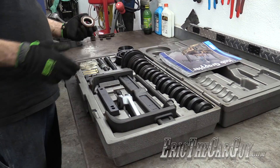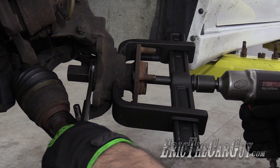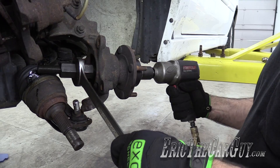What I did do today is this Nissan that's behind me — I was able to replace the front wheel bearing with this alone. No press, no nothing. I'm showing you footage of it now: it pulled the hub out, then it pulled the bearing out. Then I cleaned everything up, put the bearing back in, put the snap ring back in, put the hub back in — did everything complete on the car with this tool. No press required.